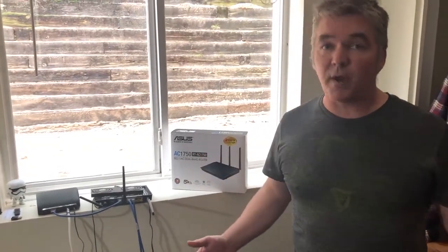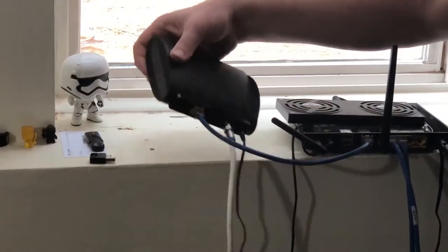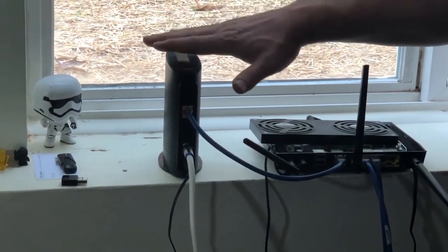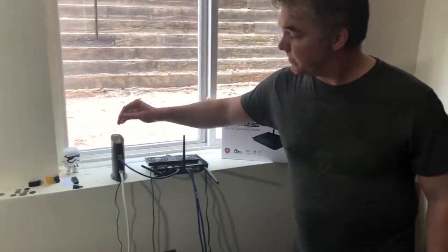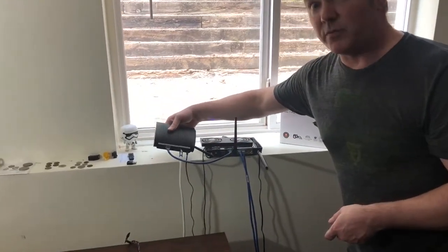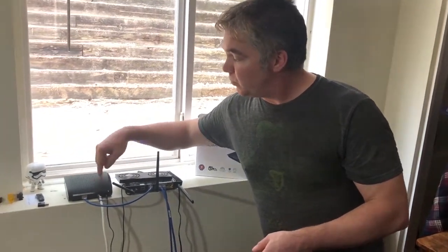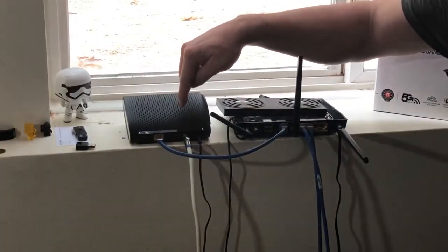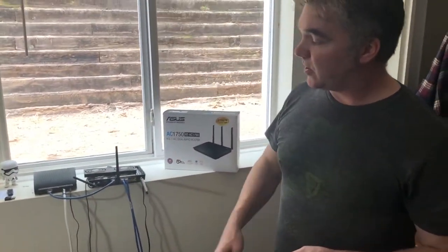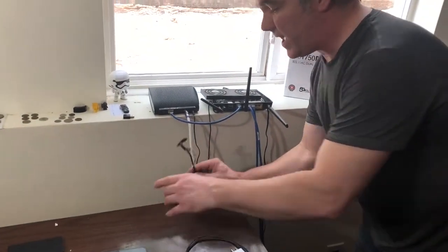However, a 600 megahertz processor is going to generate a little heat, and that's exactly what this unit is doing right now — it's hot to the touch. I've got it laying on its side, but it's actually meant to stand upright according to the factory, and then you're just forcing all that heat through even smaller vents out the top of the unit. After doing some research, peering through the tiny holes with my flashlight, and just feeling the unit in general, we found there is a small inactive silver heat sink on this side of the unit. This is where the processor is sitting — this is where all the action's happening. So I decided to go MacGyver on it and made my own little active cooling fan.